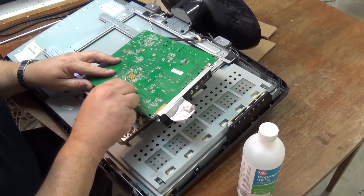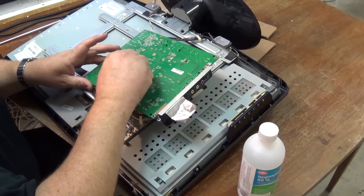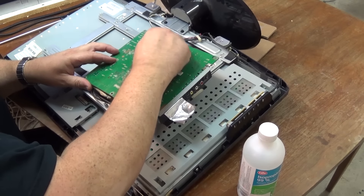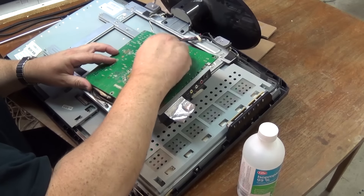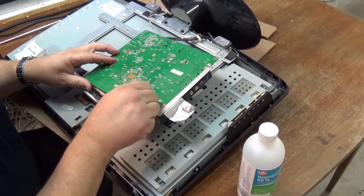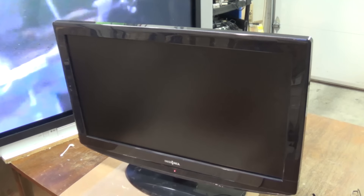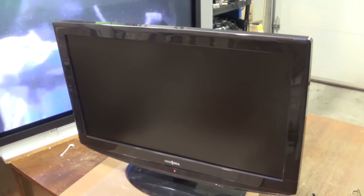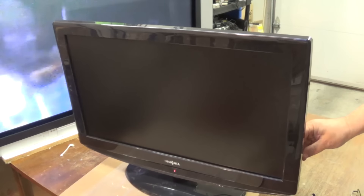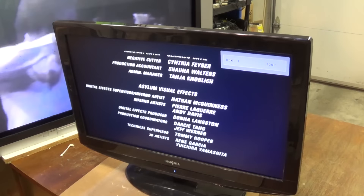This residue could just be left over from manufacturing, or something may have dripped down in the back of it. But there certainly is some type of residue on the board, so we're just going to clean this up and give it another test. The TV's back together, the circuit board is remounted, the grounds are tight again. I cleaned some residue off the bottom of the board. Power's back on — pressing the power button — the TV's turning on. Let's see whether it's going to go back into that volume mode with the volume stuck all the way down. Oh look, it hasn't done it yet — that's a good sign.